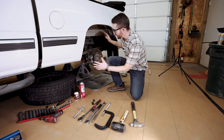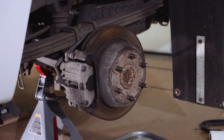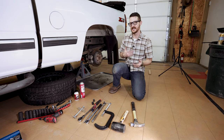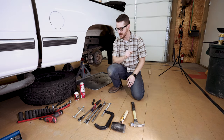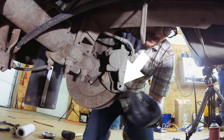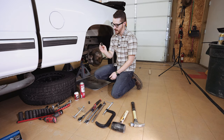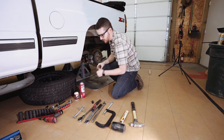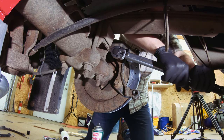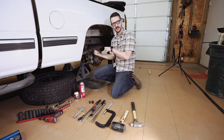We've got the back of the truck up on jack stands, nice and secure. I already cleaned this side. The rear is a lot the same as the front but a couple things are different — the hardware, your pins, and your caliper bracket bolts are different. You're going to need a shallow 18-millimeter and a shallow 12-millimeter socket, along with a smaller 3/8-inch head torque wrench because there are some clearance issues in the back.